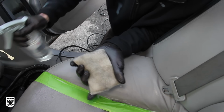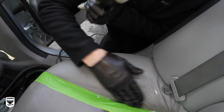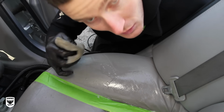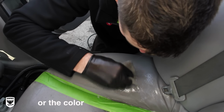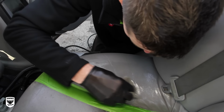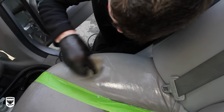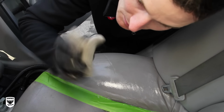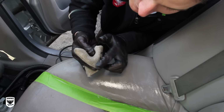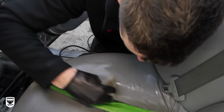All right, with the scrub pad, I'm gonna take a little bit of cleaner, get it on there, maybe a little lubrication on there. All right, so now I have the cleaner, and I take my scrub pad very lightly, because you don't wanna go through the hide here. And I'll just get a little bit extra cleaning power on some spots. Like over here it came out perfect. But I'll just, see, I'm very lightly, I'm sticking my finger in it just like this. So it's just covering the palm of my fingertip, if that makes sense. I just give it a little bit more pressure.